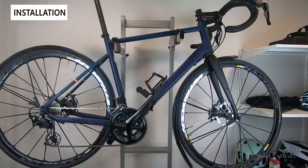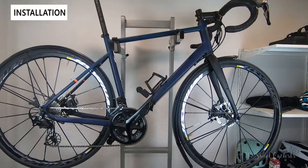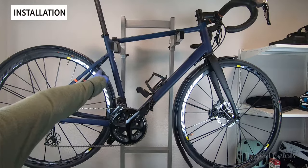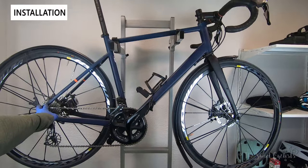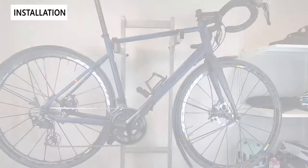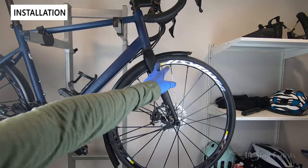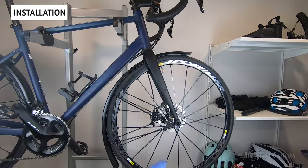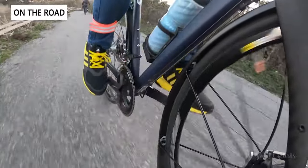After final adjustments, the fenders are fairly even all the way across. The rear struts required major cutting due to the eyelet position, but they look great when done. Torque the adjustment bolts to about one Newton meter — just hand-tight — then tighten down the frame attachment points and you're ready to ride. To remove the fenders later, just take off the eyelets, two frame attachments, and the fork attachment. Make sure to place the bike on the ground and verify everything looks correct before fully tightening — for example, adjusting the front fender bracket forward of the fork improved the look significantly.